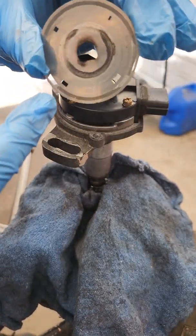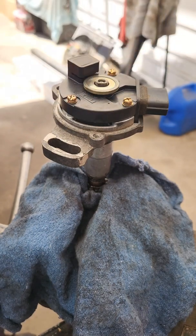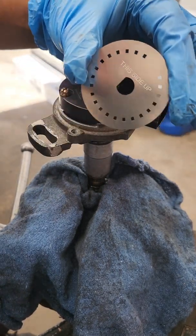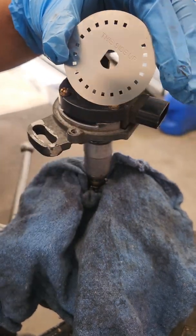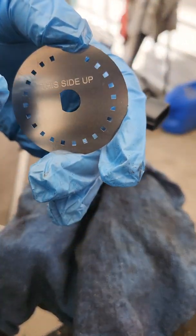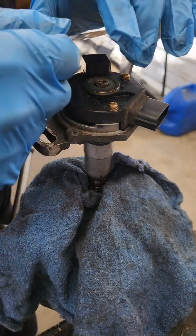As you can see, there are a lot of grooves in the wheel — it has 360 degrees of resolution. The new one has less; it's a more modern style. It should give a better reading and less chance of misfiring. It is marked with this side up, so make sure that face is up.